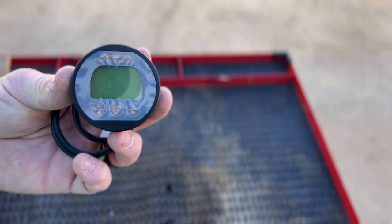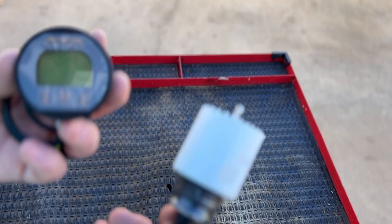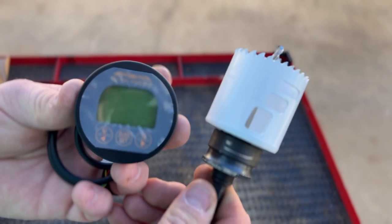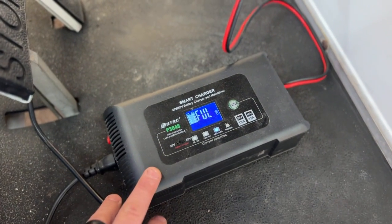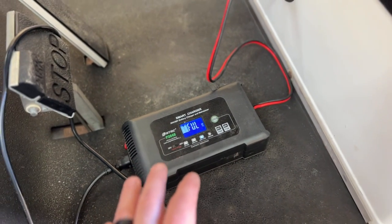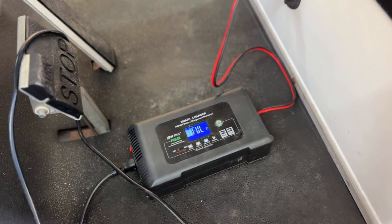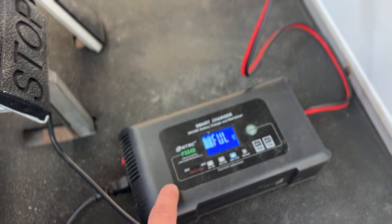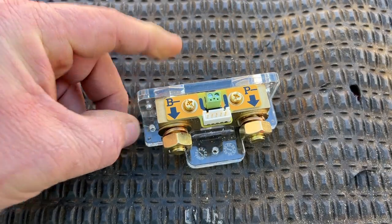You'll also have the cable that goes between your shunt and your battery gauge. To mount the battery capacity meter you're going to need a few hand tools; the only specialty tool you'll need is a two and one-eighth inch hole saw — I'll include links to both in the description below. Last night I went ahead and put the batteries on the smart charger. You don't really need them fully charged to install it, but to program the capacity meter they need to be fully charged, so I did that as a prep step.